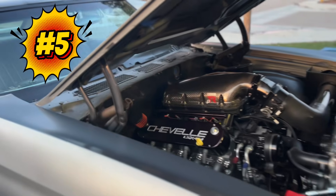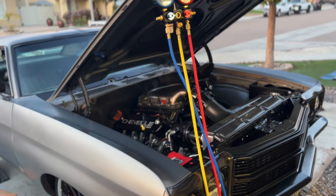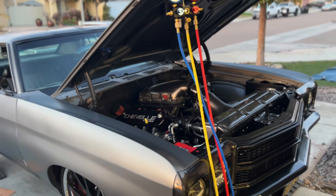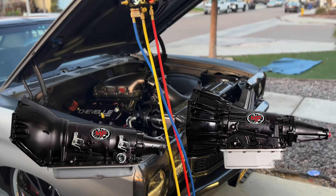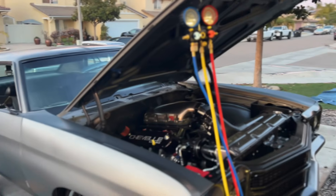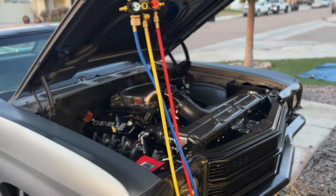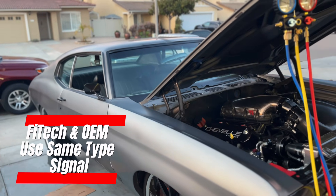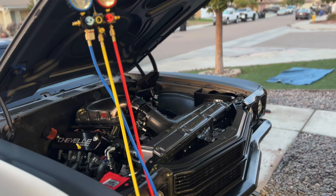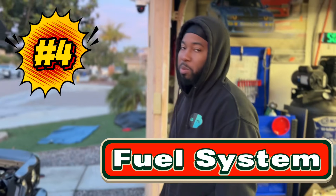Number five is the brake switch. If you don't hook up your brake switch — and this applies to automatic transmissions, specifically newer ones with a torque converter clutch like the 4L80E or 4L60E — what happens is your torque converter clutch either doesn't engage or doesn't disengage. The car just starts running funny because the clutch isn't getting the correct signal. There are different ways to hook it up depending on whether you have a Holley Terminator X, FiTech, or OEM system. People get excited after the swap and forget little things like the brake switch.